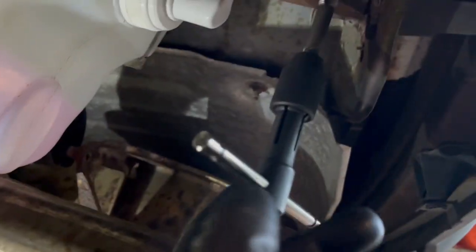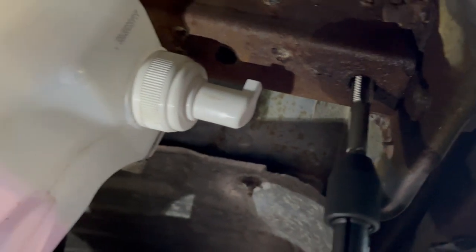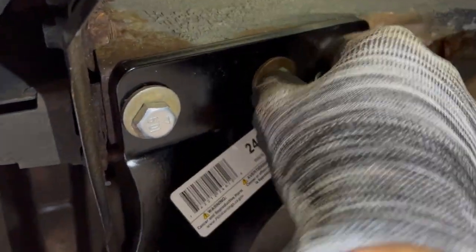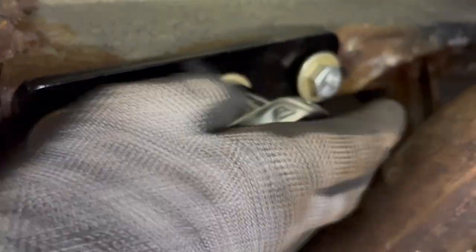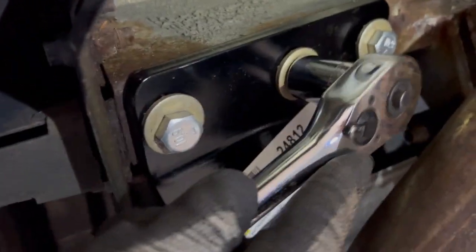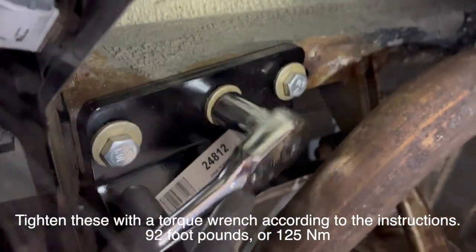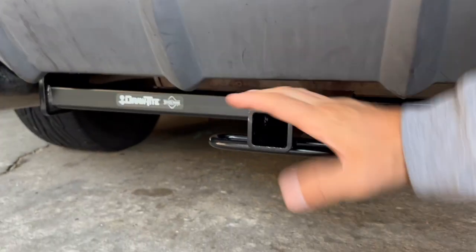I've got the car jacked up to give myself a little extra room to work, because particularly on this muffler side there's not much room to even get to those weld nuts. And then finally, once you get it on there finger tight with these bolts, compress these washers here because they are kind of concave or convex, however you look at it, and snug those up. Now we've got that trailer hitch on there and we're good to go. Thanks for watching the video and I hope that it helped you.